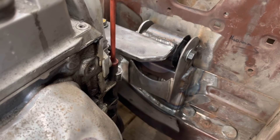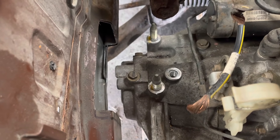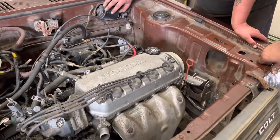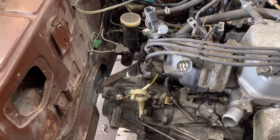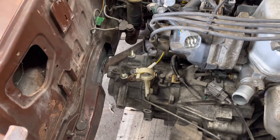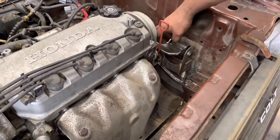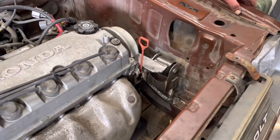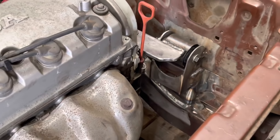So it's half in then? It is half in. I noticed that you've cut a section here. I've got a dog bone mount. So there's a section here to complete still. We cut the window because obviously the engine is physically wider. We could get it in, but with the mounts that we've got, it had to push over that way a little bit more to get this mount in. Because that's the thickness of the mount there and the way that was going to work, it's pushed it over that way a little bit. We'll infill and box that in anyway, so it's all strong and safe.